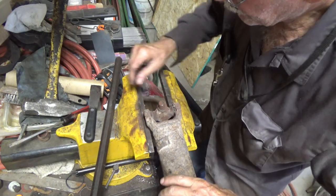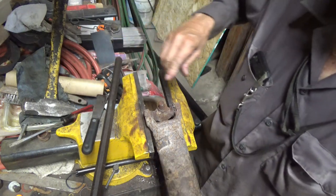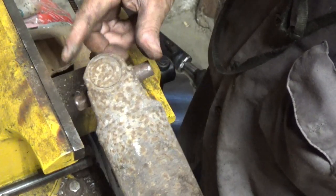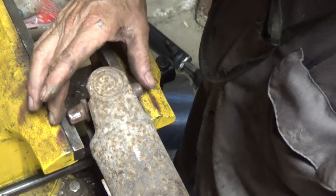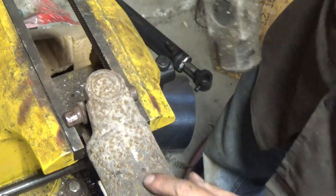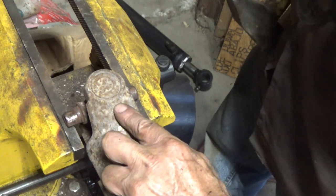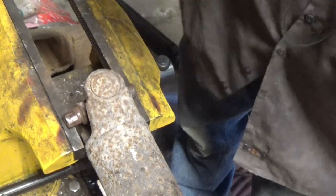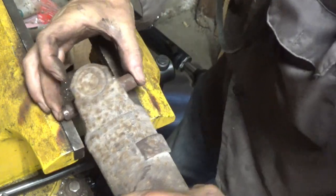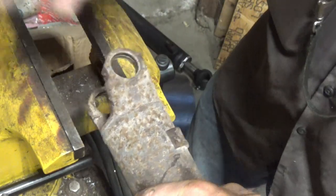There goes that one. I'm going to get this other ring out of there and then we'll knock that out the same way. Now I'm more on the end of the vise because I'm not holding the ears of the shaft in the vise — I'm just holding the u-joint itself. I've got to hang on to this so it doesn't slide off and fall away. Be careful not to hit this part of the shaft; it will dent. Behind the weld on the main shaft this part up here is solid steel — it's heavy — we can hit that. Okay, we got the u-joint out; now we're going to press the new ones in with the vise.